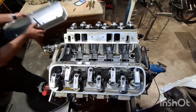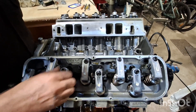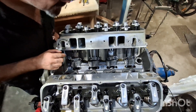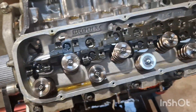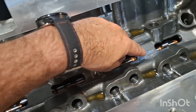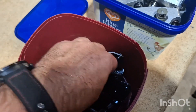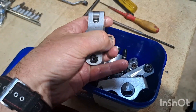Let's see what we've got. So all the rocker gear is off, the lifters are out. We've had a good look at the cam lobes from here and everything looks okay so far. Nothing untoward — the rockers have no damaged rollers or needles, and the lifters look pretty good. Rollers are all okay, rocker tips are good, and rocker shafts so far are fine.